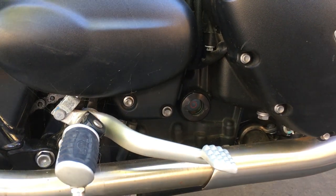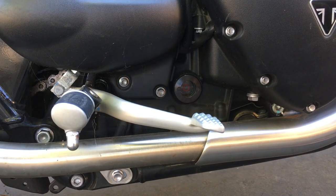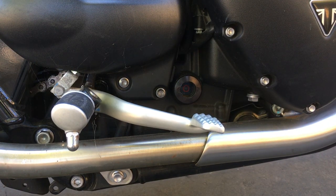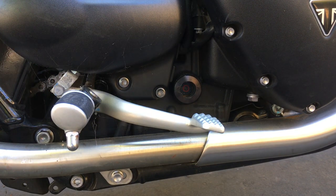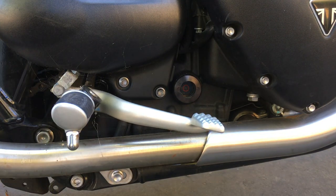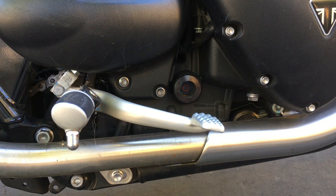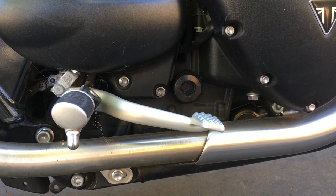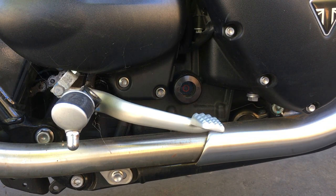So usually, before I start the engine, I fill it to the top of the screen on most bikes, and once I start up and everything, it usually comes out to be perfect. So my hunch is that it's right with this bike as well. So let's fill the rest of this oil, I think. So 3.5 liters, looks like. So that's the rest of it. So 3.5 liters, so I guess I don't need to go to Walmart to get an oil filter or more oil. So looks like I'm good.